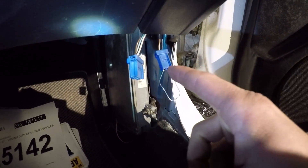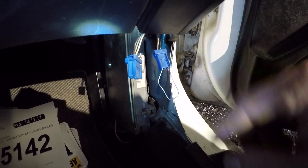You need the one with the two wires and it's gonna be blue like this. You take a paper clip and stick it in there — you gotta jump it out pretty much. Once you do that, you go over here, turn your ignition on, look at your check engine light, and watch for your engine code. You'll see it start blinking and you gotta count those flashes. When you turn the key, just turn the car on — don't actually start it — and watch and count the flashes.